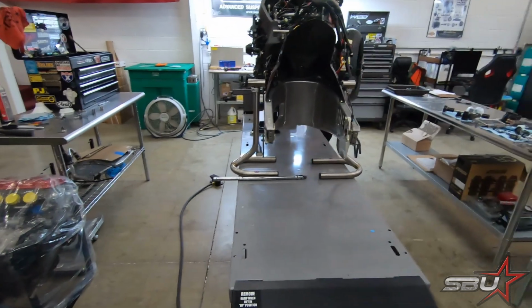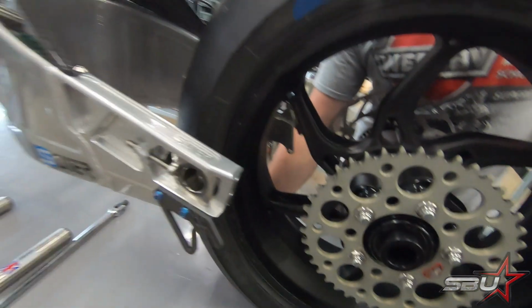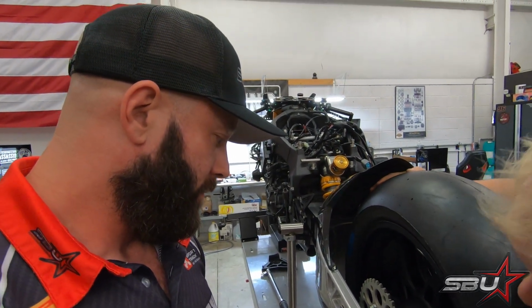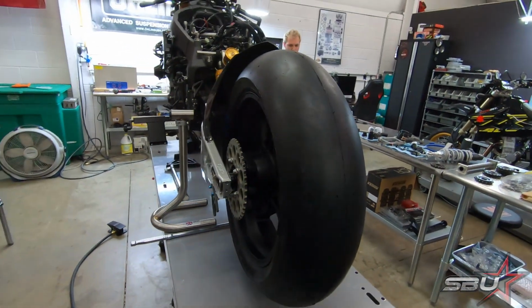All right, so Martin's just going to go ahead and test fit this. We've got the lifters and everything in place now. We do not have our caliper fitted because we're lacking a set of 7 by 20 millimeter bolts that we're going to need to fit our rear caliper, which I'll show you next.